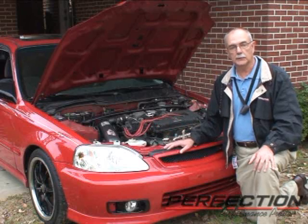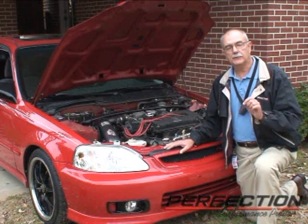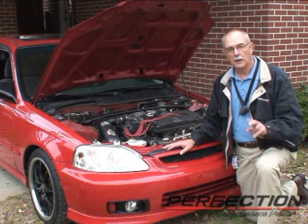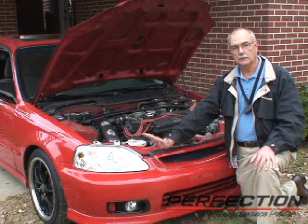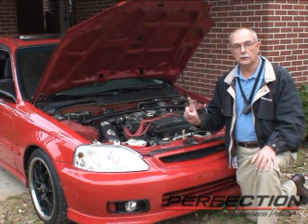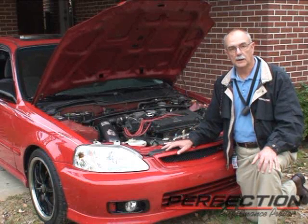Now we just took a listen to it. Today it's a little bit cooler than it was when we first shot the video, and we've changed the oil in the gearbox, put the Honda recommended lubricant in there. That change right there in the cooler temperature, I think, has made a change to how we're hearing the noise. You push the clutch pedal down, the noise goes away. You bring the clutch pedal up, we still hear a little bit of noise. So I think we're looking at a little bit of gearbox wear.